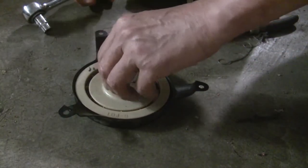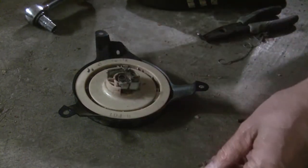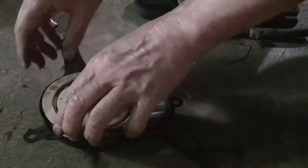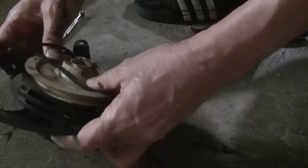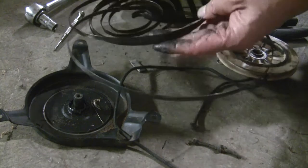So I have to detach the pulley from the housing. Take a photo of all these small parts so you can put it back later. Well, this is not good — the spring all came apart, and I have to recoil the spring back in.